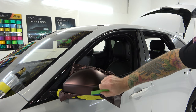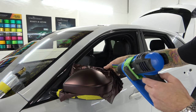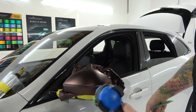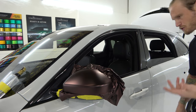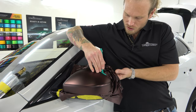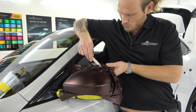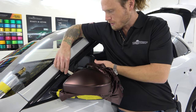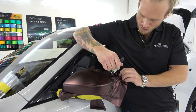Let's finish up some of this. No wrinkles on the edges, which means we're rocking — we're good to go, almost ready to cut. What we're going to do on the top side is pre-tuck the film a little bit. If you don't pre-tuck the film, we run the risk of showing some of the paint or white. We can also cut some of this away now since the tape is there, because I have too much extra vinyl — it gets in my way.